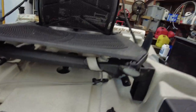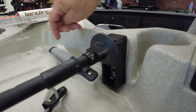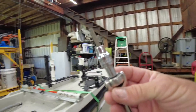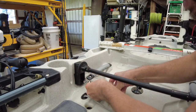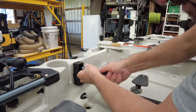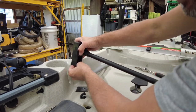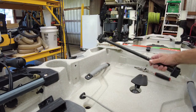The seat is still in, as you can see — it's all back to stock right now. First thing we're gonna do is go ahead and take the seat off; everybody knows how to do that, so we'll just set it to the side. We have to get this system out, which has some Allen bolts up under here on this side, and on the other side is the actual adjuster lock plate. The easiest way is to take this side loose first using a 3/16th Allen wrench — take the two bolts out on this side. I have the bar all the way up, so I'll take the bottom bolt out first, then roll the bar down, take the top bolt out, set the bolts to the side, raise it back up, and carefully slide that off. There's a little spacer behind it on the bottom, then we can pull this whole assembly out.